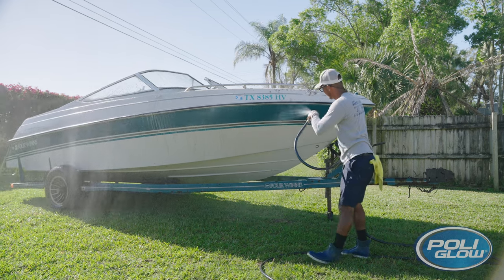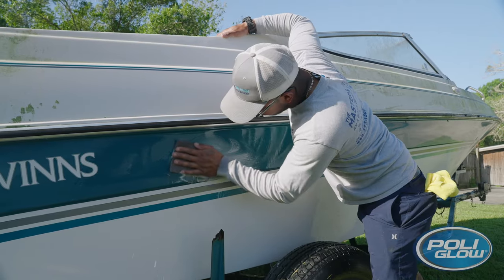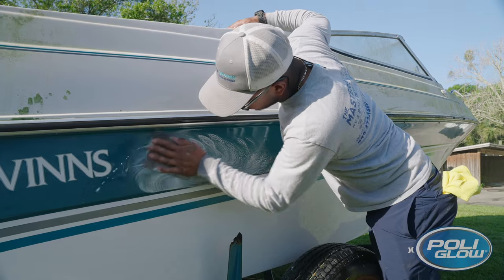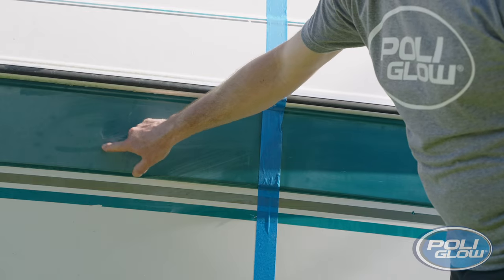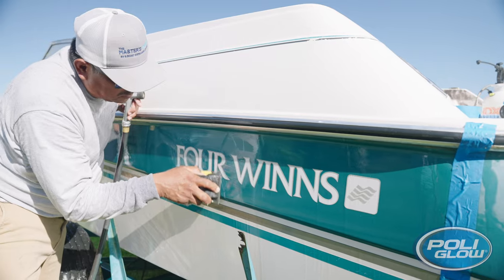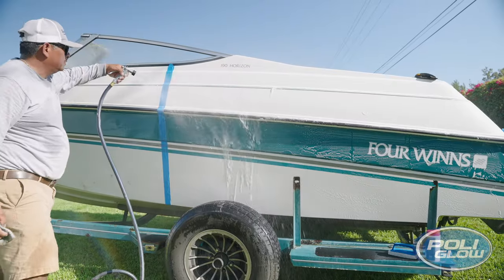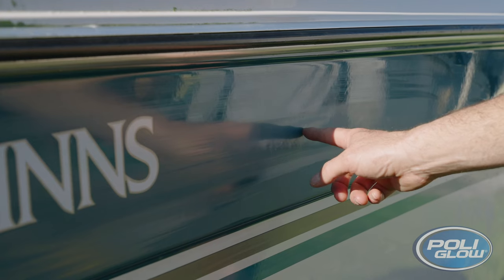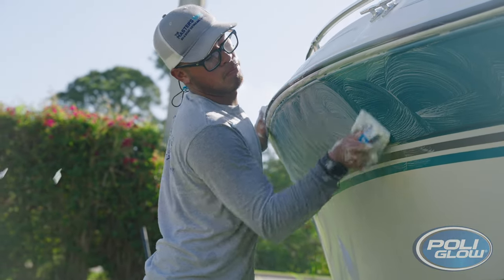In the case when you have a heavier oxidized fiberglass surface, you want to use a completely different product — Polyox. Polyox should be used with our ultra-fine sanding pads, which are more aggressive than the white scrub pads. The white scrub pads won't scratch your surface, but the ultra-fine pads are designed to take off heavy oxidation, deeper staining, and rust spots. In darker colors, where the surface absorbs the sun's rays more intensely, you might need Polyox to get that heavy oxidation off. Everything will still look dull after this step — the gloss comes from Polyglow.